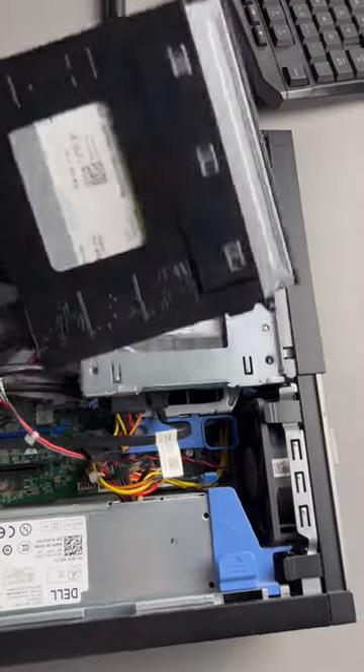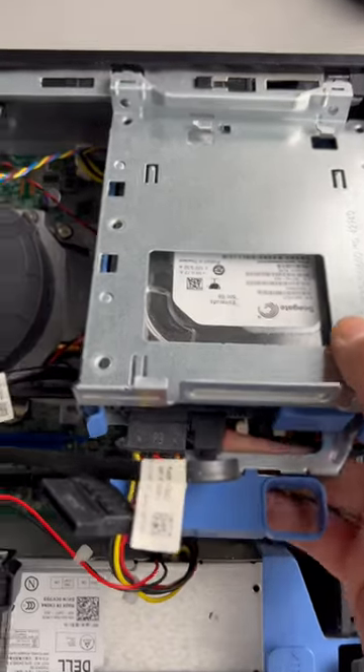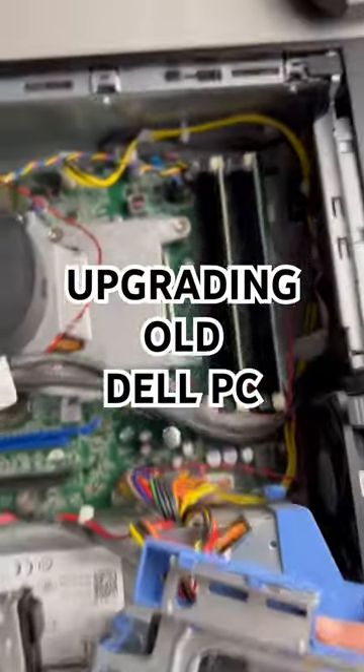After you put it aside, you have to reach into the hard drive lock and push it to the left, then pull up and take the hard drive out. At this point you can change the hard drive to an SSD if you want to, but the RAM is hiding underneath it, and now we can finally add more RAM.